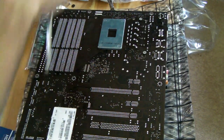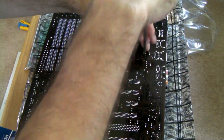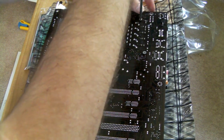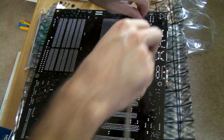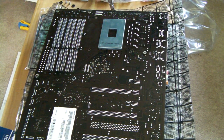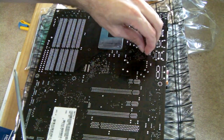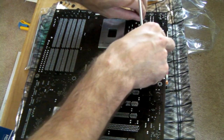You'll also see me removing the MOSFET heatsink. The big reason I said earlier not to do this is because it uses a very thick pad, and there's a very good reason for that. The MOSFETs are actually slightly below some of the other components, and if you take off that pad and put the heatsink back down, that heatsink might start shorting out other things on the motherboard. That pad actually elevates the heatsink from all the other components. You can do it if you really want to, but you'll either need to use another pad or modify the heatsink.